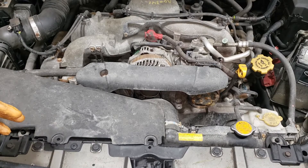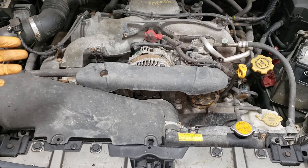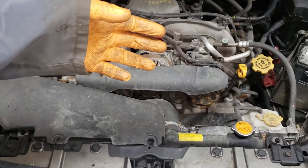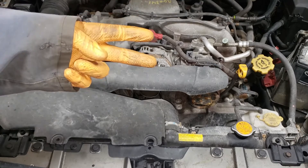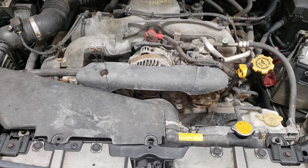What you're going to need to do is determine whether you have a bad alternator or not. In order to do so you will need a multimeter. I know for sure our alternator is bad because our battery light came up on the dashboard, but that can mean two things: either you have an overcharging alternator or an undercharging alternator. Most times it is an undercharging alternator that you will have. So let's go get our multimeter and I'll show you how.